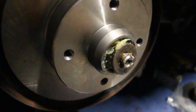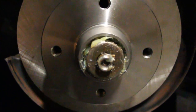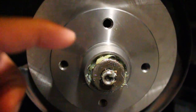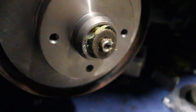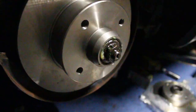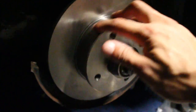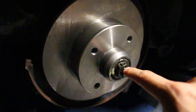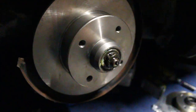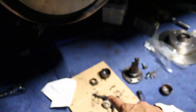Bearing has been packed and it's all in there. This little washer will only go on one way - there's a little notch on the side, it'll only go on that way so you can't possibly mess that up. It only goes on one direction. Our nut is on - when you tighten this down, I always do it a little bit past snug, enough that this still spins but it's not locked up and it's not loose. That's all I've always used, no problem.